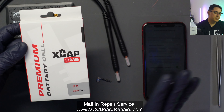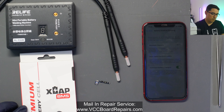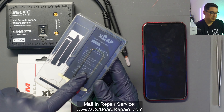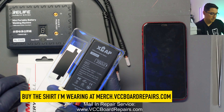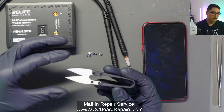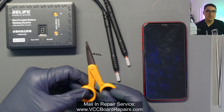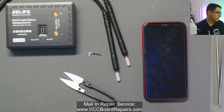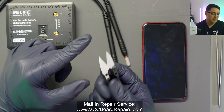Make sure you buy from Injury Gadgets, which I will link down below. You need one tag-on flex and one battery. Inside the battery package are stickers to glue it back into the frame, the battery cell with two connections, stickers, and a little plastic so you can get almost that OEM look afterwards. Lastly, you will need ceramic scissors, because we're going to cut the battery leads and you don't want to use metal scissors — they're conductive, and if you cut through the positive and negative at the same time you'll short them together.